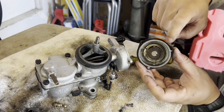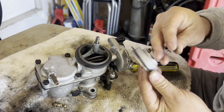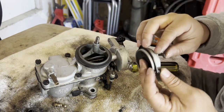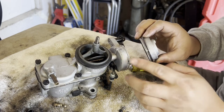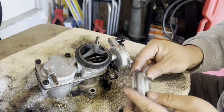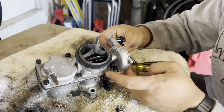In order for that to ground out, it needs to have clear contact from metal on this plate here onto this side of the choke. And then this bolt here will thread into this part of the carburetor and then ground itself out onto the carburetor. But because I painted this plate here, there was no way that this was going to conduct onto the body. So even if I plugged it in, it wasn't going to work. I think this time around I may just shave this paint off — I know I'm still not going to plug it in, but at least it'd be nice to know that these will still work if I wanted them to.